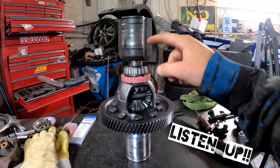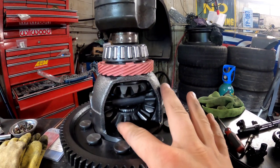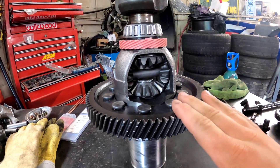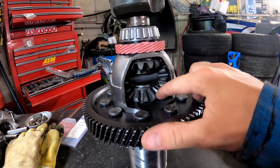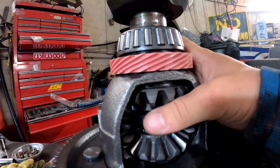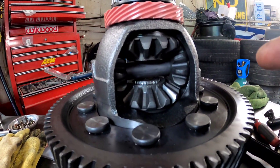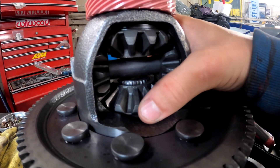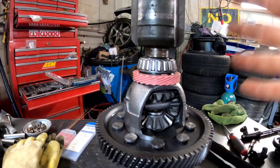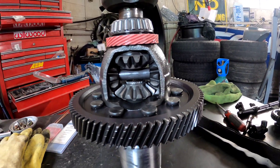I've got my axle into the right side and my axle in the left side. I'm going to weld this gear first because gravity is holding it into the seat of the diff — so I'll weld two corners here and maybe two more, so about four tacks. Then I'm going to flip it and do the other ones, let gravity do its thing. I'll weld, weld, weld, weld, then flip it and do the same thing, then spin it and do the same thing.